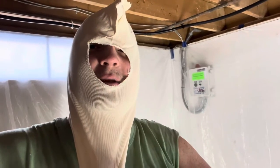The other thing you're going to want — let's talk about safety gear. You are going to want to use, especially when you're in an area like this, some really nice goggles. These goggles actually seal your face, kind of like a swim mask, so you're not getting any junk in there. You're going to want to get a hood sock, probably just to keep the paint off your face and hair. And the most important thing — the thing you really don't want to skip out on — is a respirator. A respirator is more than just a mask; it's a breathing mask with a diaphragm, so you're breathing through filters. I highly recommend this. Anytime you're working with paint, dust, anything, just get one of these — you can replace the filters. They're not much more expensive than a face mask, and you're throwing those away anyway.